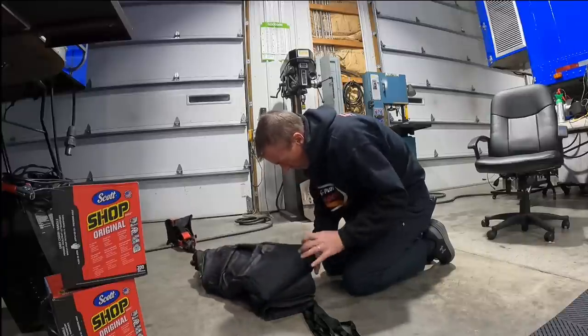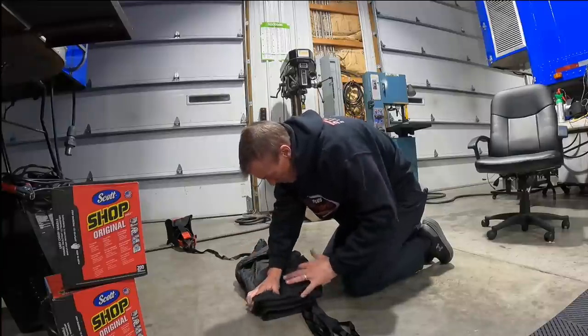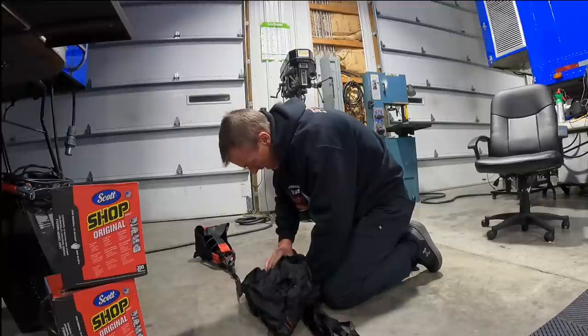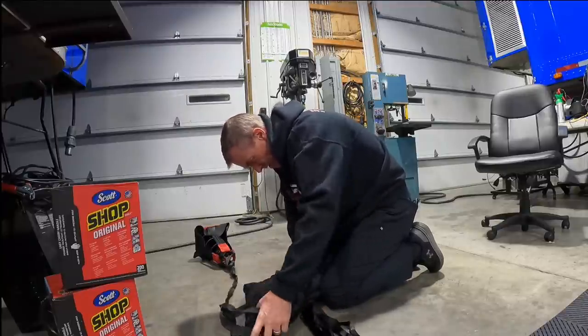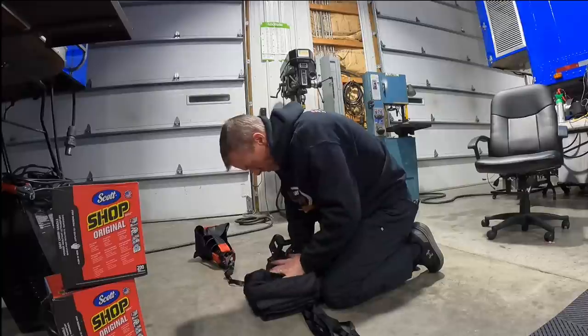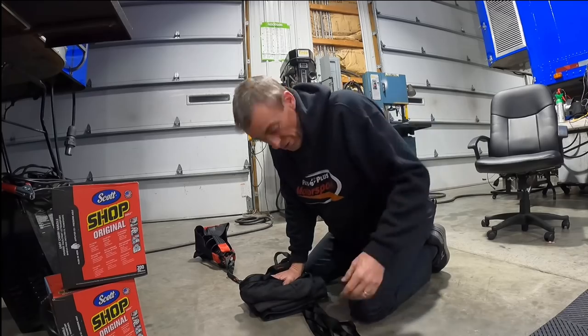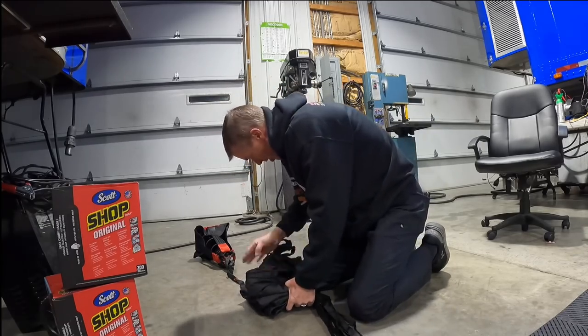Keep doing that over and over, pulling it towards the race car, S-folding, trying to keep it square. S-fold again. You can kind of see it's baggy here, but that's the end of the chute where everything comes together. Turn it back into a square, then pick it all up and walk to the car.